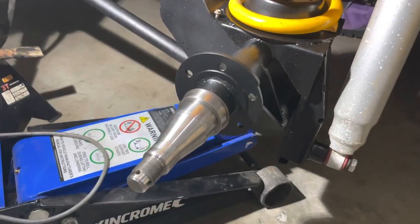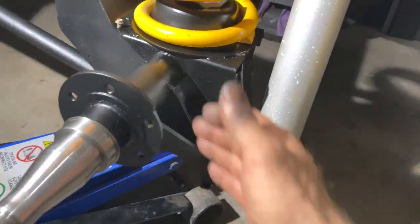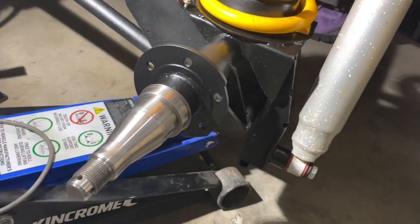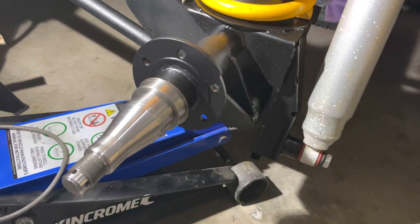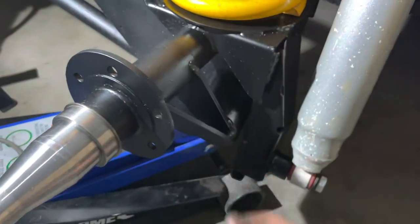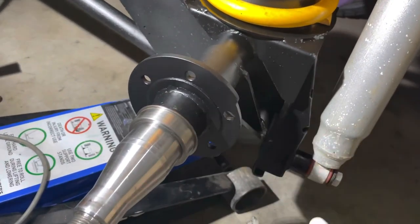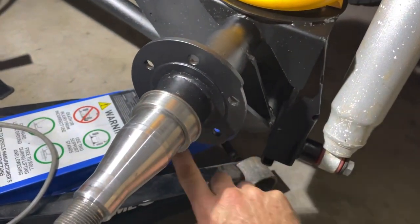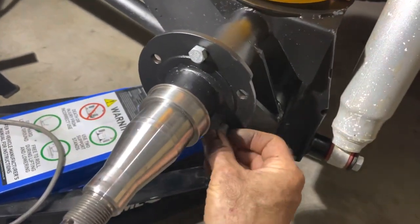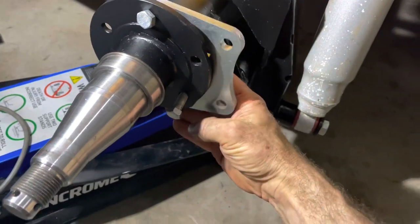The first thing you want to do is remove your old brake drum and backing plate, clean it all up, make sure there's no rust or scale behind the drum brake mounting flange, and clean all the grease off your stub shaft. This bracket is going to mount on the rear side of your axle, picking up on four holes around the mounting flange. Put some bolts in there just to sit them in place.